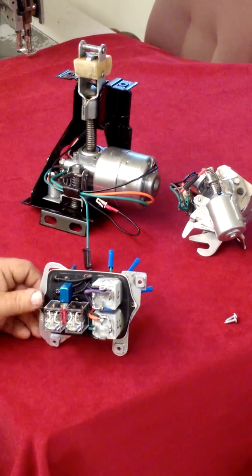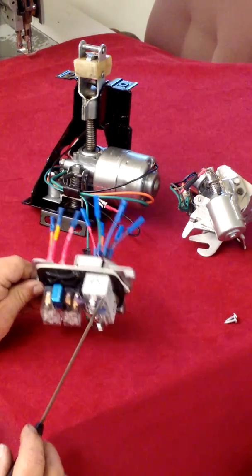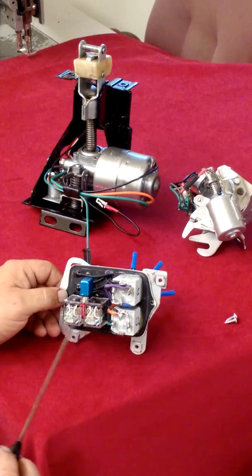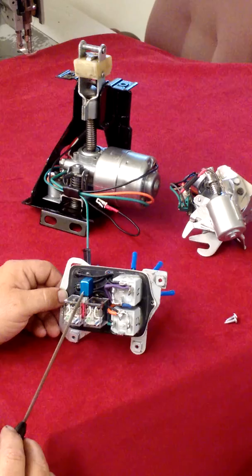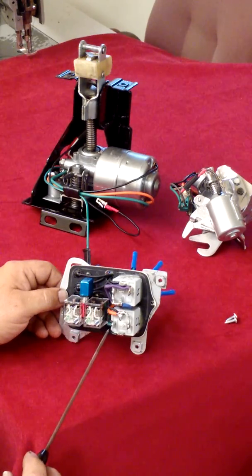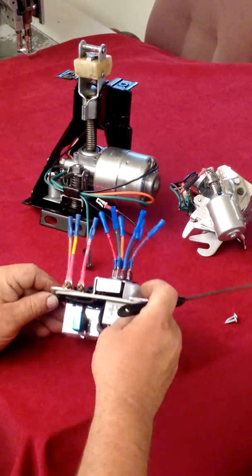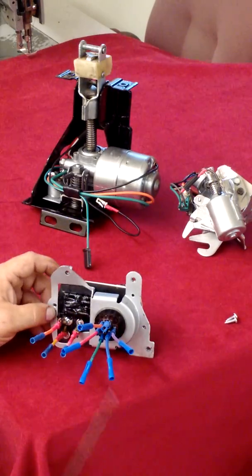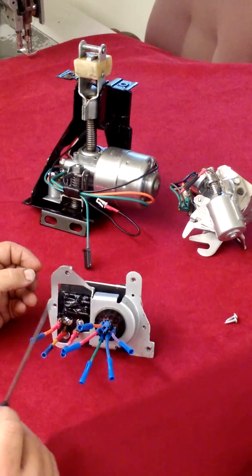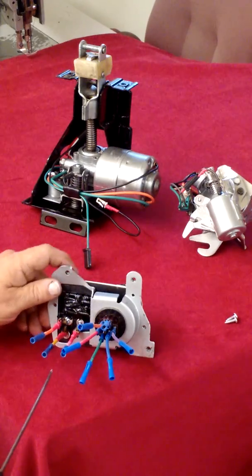Looking at the brand new relay, we used heavy 30 amp triggers for the latching, and then we used heavy 10 amp latching relays. These are double pole, double throw, and then a heavy duty 15 amp circuit breaker for the power feed coming in. Real heavy 12 gauge wiring coming off the components, because this does have to conduct quite a bit of current. On the back side, we built this. We used a pedestal top latching relay, and I'll show you why in just a moment. But let me go over these components here.